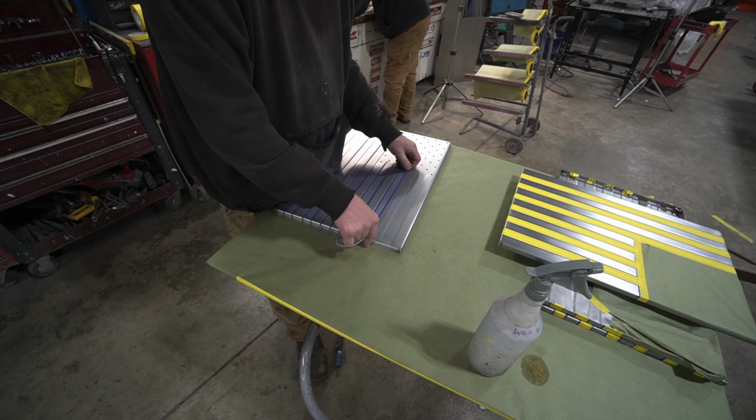Got those things all taped up, clean, taped, we blue lined them, and then we ran some yellow across here. For the red, we're going to over reduce our red, and we're using a ruby red from Lesonal from a past project we had. That's going to be our red, and then on our blue, we're going to use a lightning blue. I believe it's a Ford color we used on a couple projects before. We had some leftover. Both those will get over reduced, shot through an airbrush, because I can control the amount of coverage I get easier than I can with big guns. So I'm going to get those cleaned up, get our paint mixed up, and then get to painting.